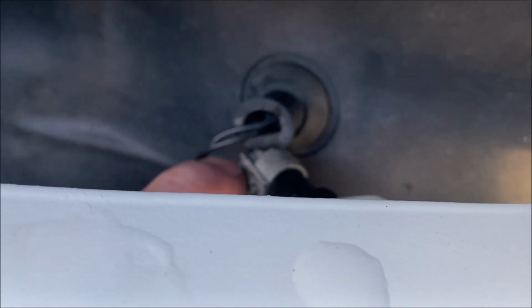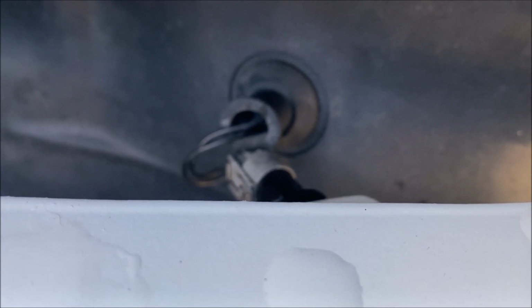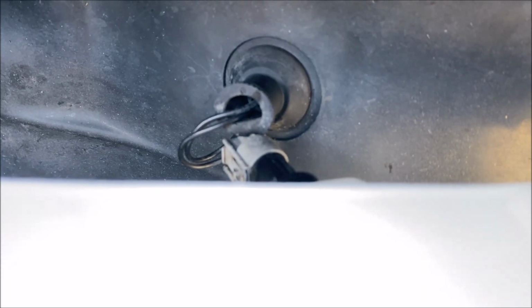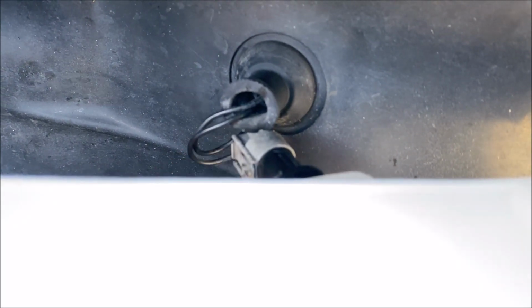The sensor releases with a little grey clip, and you just push the release tab in on the side. You might find it easier to release it once the bumper cover is slightly off rather than trying to do it when it's still in situ. But that is it down there. Essentially just make sure that's released, because that's the last thing holding the bumper on.